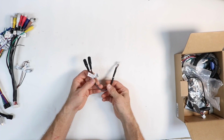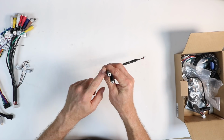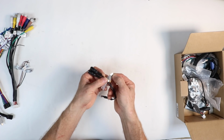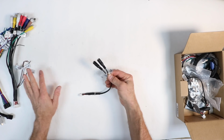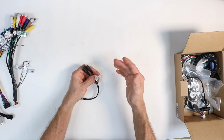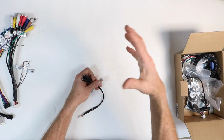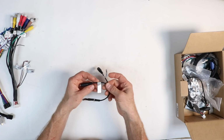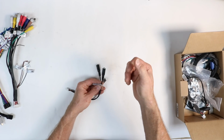Now, since we were talking about steering wheel controls, you have your second harness here. This has 2 black 1/8 inch style headphone jack looking inputs on it. One is going to be SWI, which is for if you don't have the older resistive style steering wheel controls, you can add something like SWI CP2, SWI RC, or an interface module that has steering wheel controls built into it, like an RP4 or an RP5. You also have the IR input. This is going to be for if you plan on getting the controller for it.